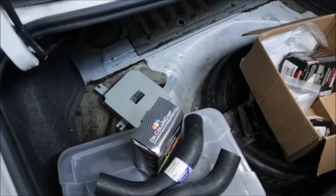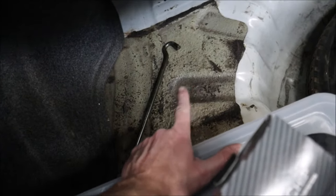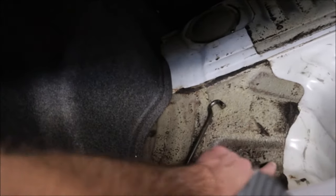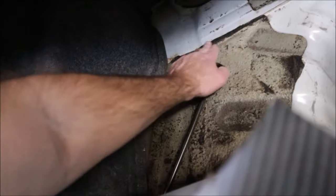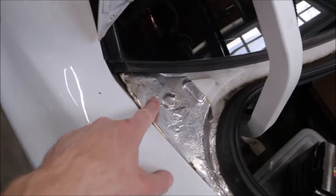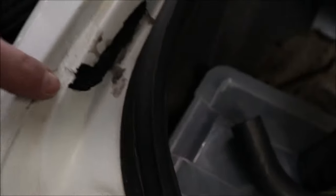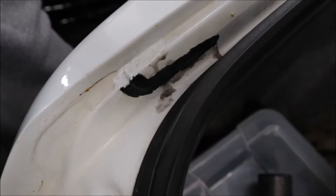A Gates thermostat that won't be going in the car. The trunk isn't so bad. Looks like they removed the sound deadening at some point — going for the weight savings technique. It looks like all the tar stuff has been removed. The backer board is still intact though — those almost always get destroyed or removed. This is interesting: I don't think this extra seam-sealer material is factory. I don't know if they were trying to hide some surface rust.